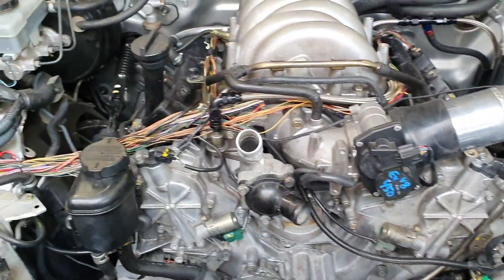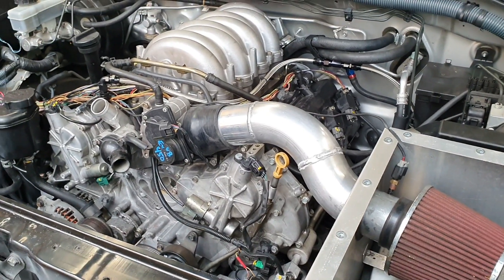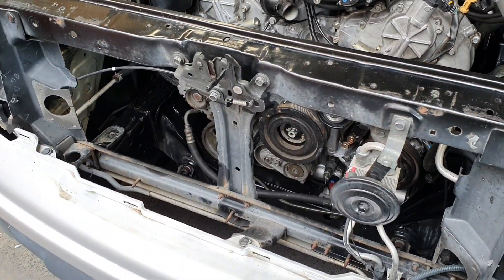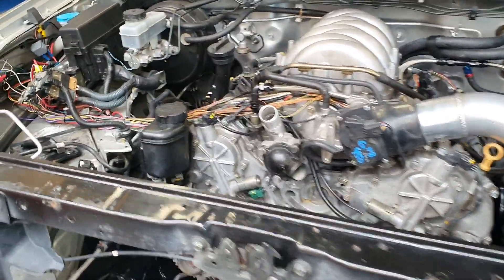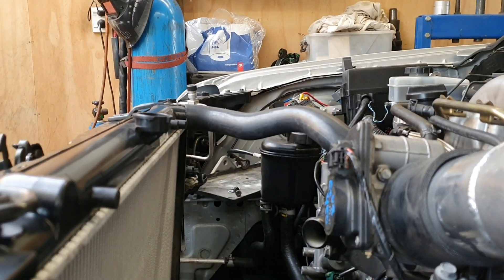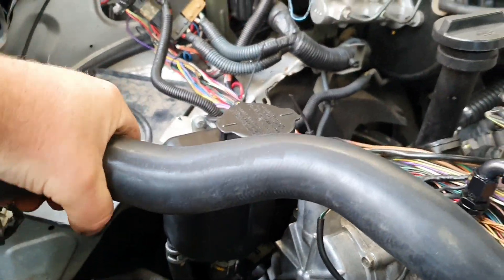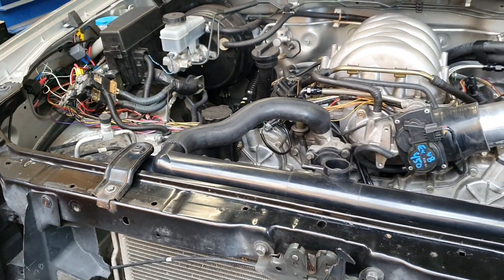The oil filter didn't turn up — a bit of an accident with the order. I said to put it on the shelf but didn't realize they wouldn't stick it with the other bits. I've got a couple of fans and the radiator, so I'm going to get those in now, and while that's happening the filter will turn up. At that point I'll do the throttle calibration, put the battery in, and turn the key to see if it starts. The top radiator hose is nearly all uphill with just a slight kink — I can give it a twist when tightening. There's enough flow that it'll push any air bubbles up, no problem.